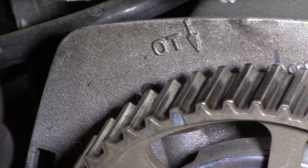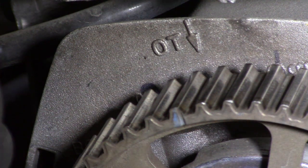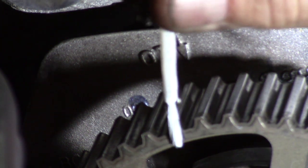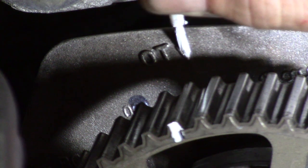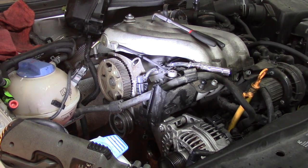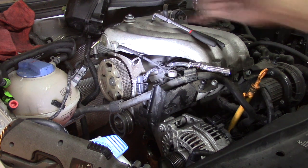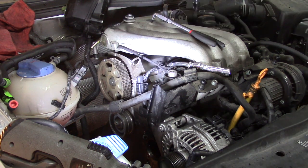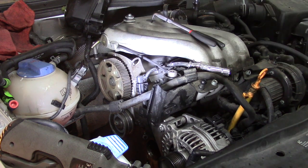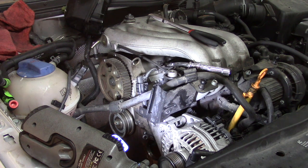If your car had the timing belt installed and it was already in time, that would necessitate that your crank is also in time — but I personally never rely on that. You never know if it might have jumped a tooth. I'm going to make some paint marks to help myself and also to make this stand out on camera so it's easier to see the alignment. Cylinder number one on these engines is going to be on the rightmost, passenger-side of the engine. Luckily the spark plugs curve away from under the intake manifold so you do have access to that number one cylinder.